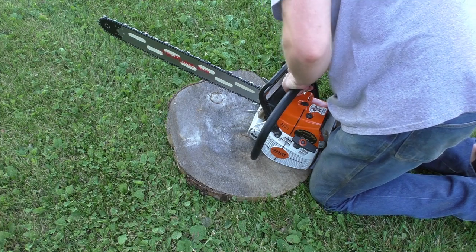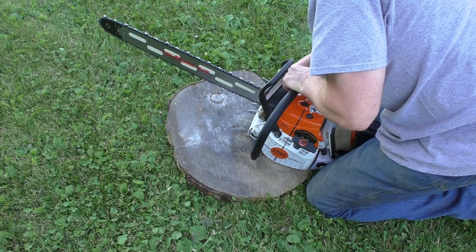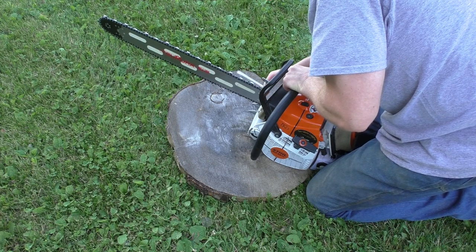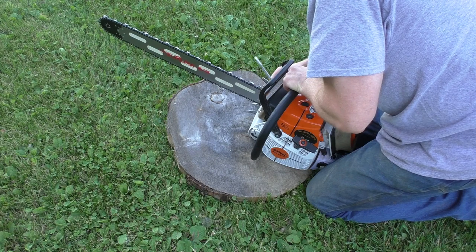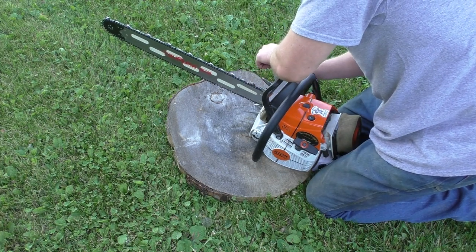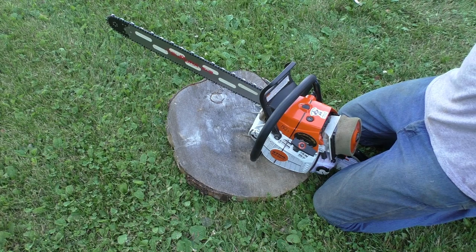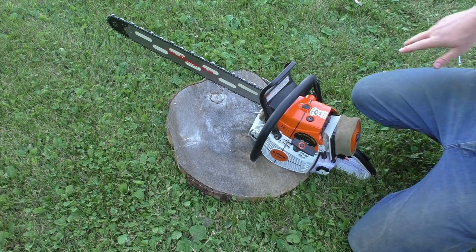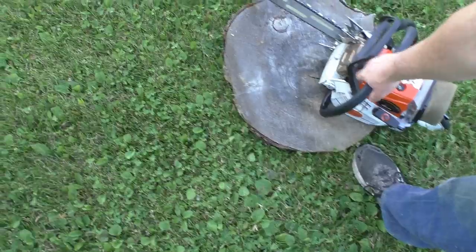They didn't call it a calibration, they call it a reset. I guess the difference is the old one reset to the factory stock settings, and this calibrates it to maximize the saw performance. That's my theory. The old reset was with the 4700 coils, C, D, E. So the coil would actually say 4700 C or D or E. I know they had problems with the C and D, and then they came out with a 4701 A, and that was still reset. And now they're 4702, and that is this new style of calibration, if you will.